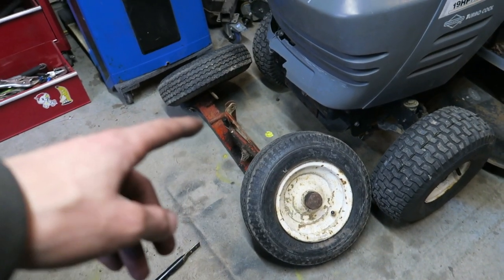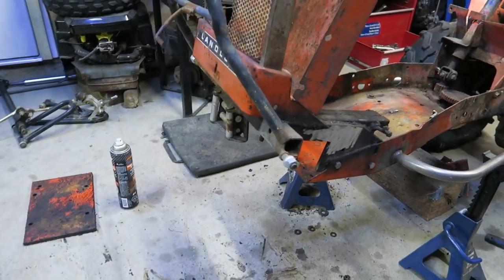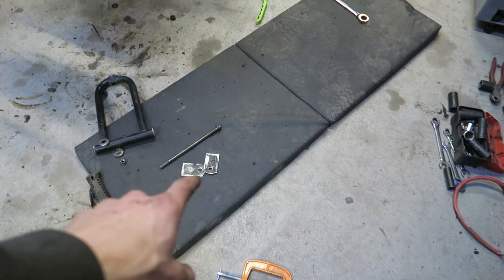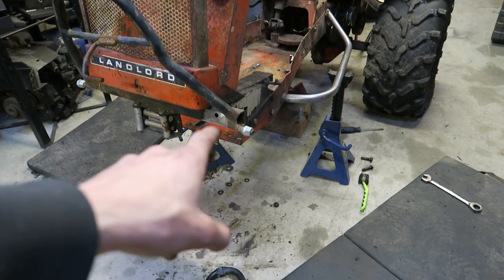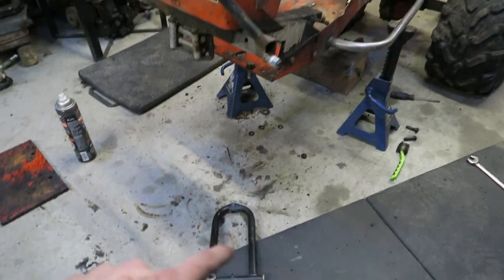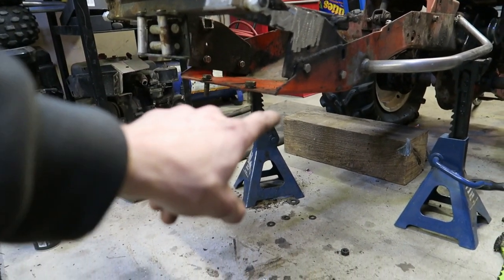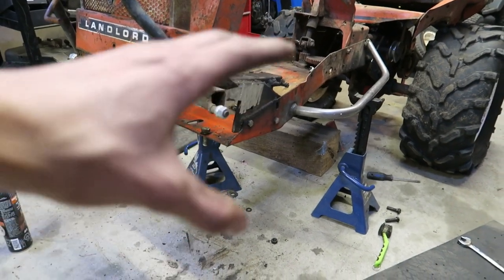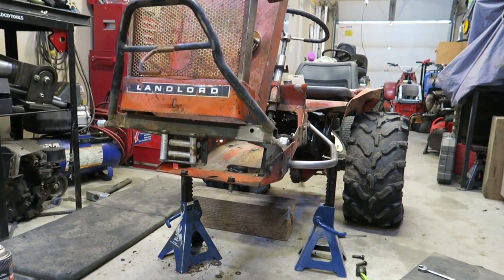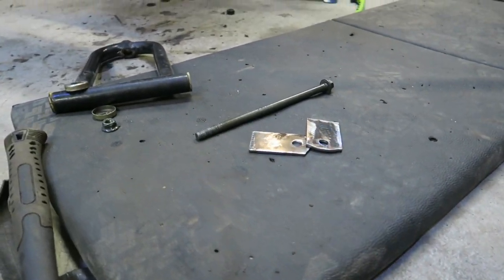The front axle is out. I started cleaning the frame because it was freaking dirty. I've got my A-arms torn apart and I'm starting to make some brackets and mounts on the frame. The upper A-arm goes on the top platform, hiding right under there, and the bottom one will be just under the frame. That should keep the spindle nice and straight. I'll replicate that on the other side.